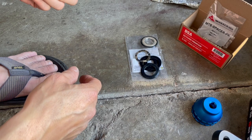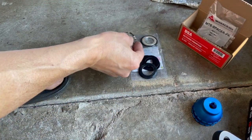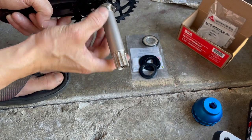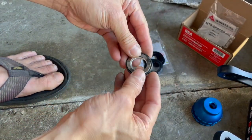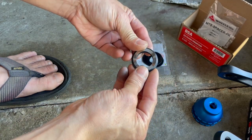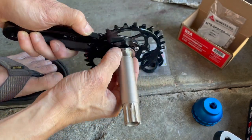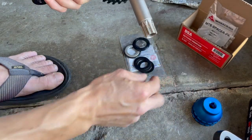I'm not sure as far as what spacing I need. I know this is the small side - those two are the small side which is on the non-drive side... oh wait, it's on the drive side. I thought this was 22 and this is 24. Let me look at this again - the spring is not on the 22 side, it's on the 24 side. So the spring is bigger because it's 24. So I think the spring goes on the drive side like so.